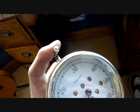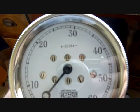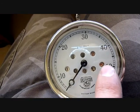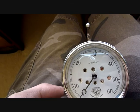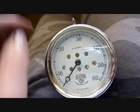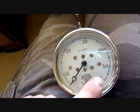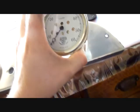You can see this trigger here — that sticks out the front of the dash through that little notch there, and when you press it, the top three digits — that's your trip meter — resets. The funny thing with this speedo is it doesn't actually record the total mileage the car has done, because it only goes up to 9,999.9 miles and then resets itself back to zero. So I'm not sure how far the car has been. When we got it, it was on 23600, which is 2360 miles — so I'm not sure how many times it's been around. If anyone else has vintage speedos and knows differently, please let me know, because it'd be very interesting to find out how far this car has actually gone.